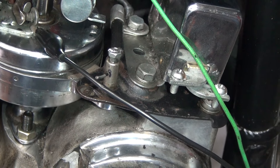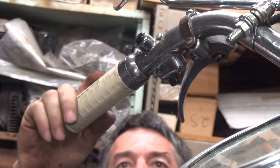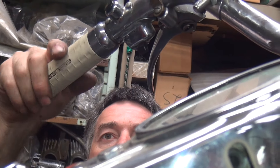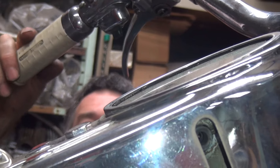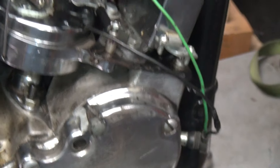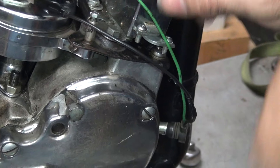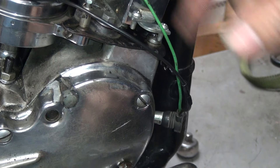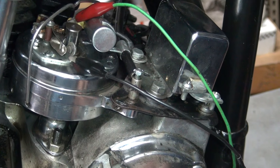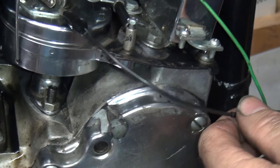Because I can feel this is all slop up here. See, look up here at the bar — not you, the camera. So you come back here and then you put it... see, this is all slop. This is tension right there. That's pulling against the stop. When you see this thing flexing a little bit, that's me up there yanking on it. So now when it's fully advanced you can go ahead and check your timing. Right now we don't know where the timing's at. All I know is the points are not open right now. I don't know how much past it is.